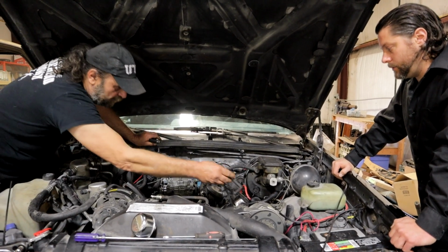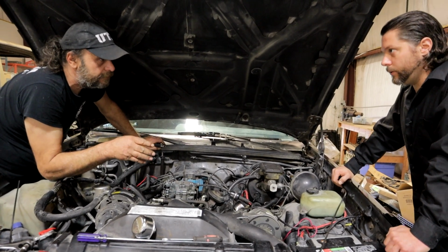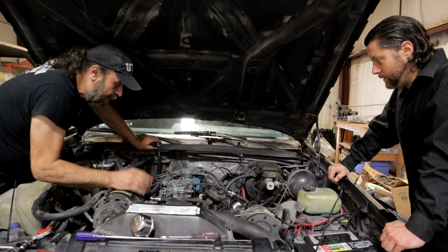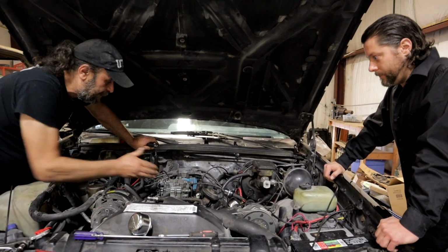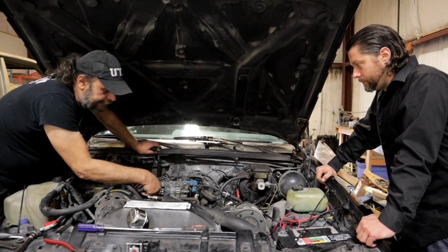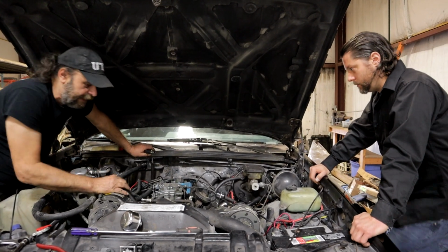So we're going to just leave this off to the side now, drive it home. You're not going to have any power brakes at all. Right. You probably didn't have very much power brakes to begin with. Not in the way of much, no. But other than that, it sounds good. I mean, the carburetor is great. The motor sounds fantastic. But I can't get an idle mixture adjustment. We can't get an adjustment until you fix all the vacuum leaks. Yeah, fix all those smaller vacuum leaks.